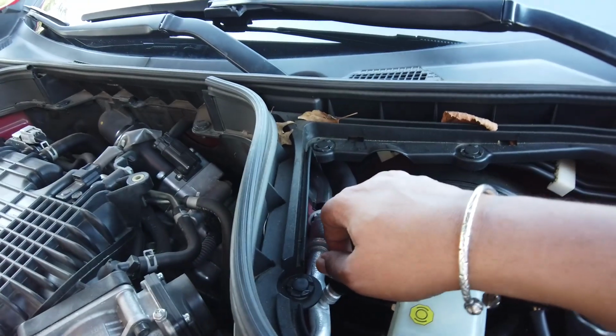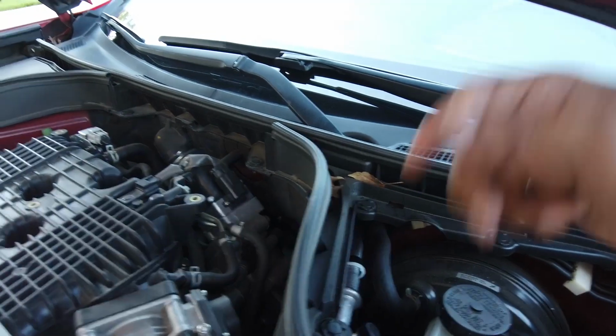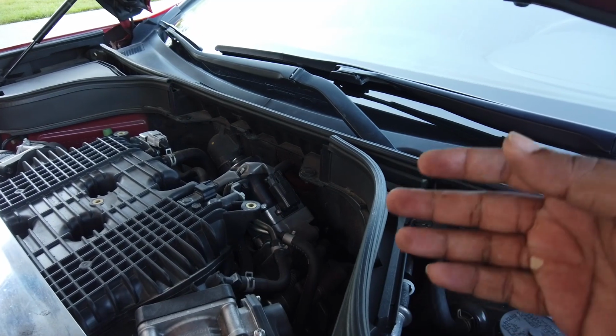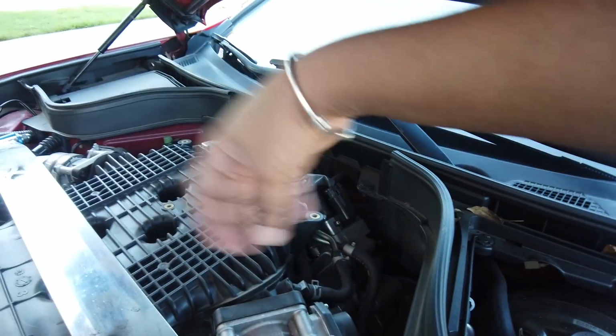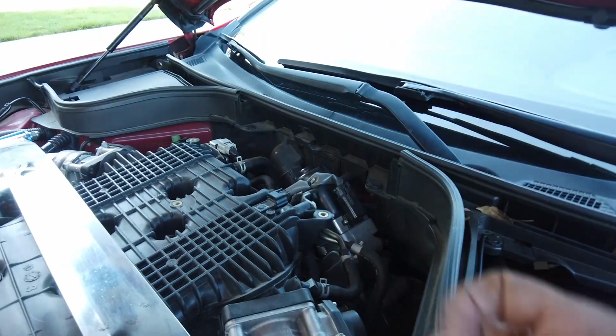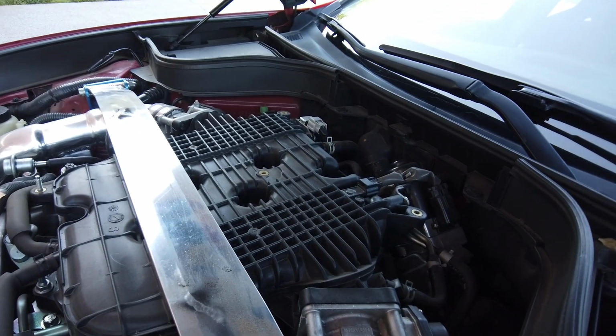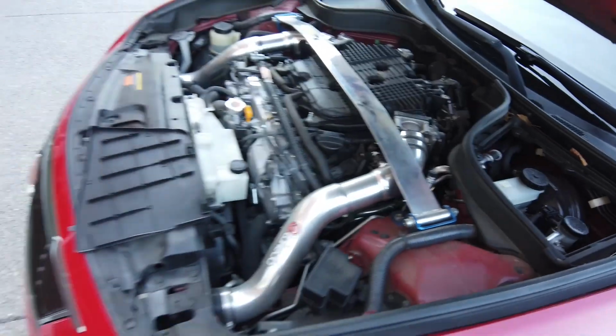You have someone in the car to modulate the throttle, keep it from stalling out, and it pulls into the manifold and gets around and cleans the car. You let it soak for about 20 minutes, and then you go for a very brisk drive.